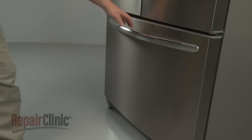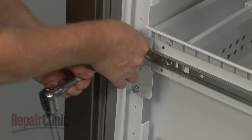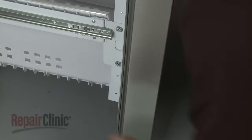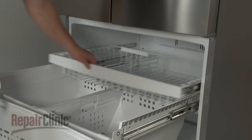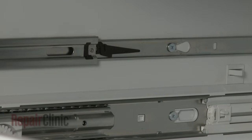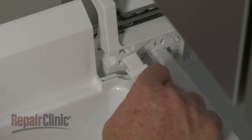To access components behind the freezer's rear panel, use a 3/8-inch socket to unthread the screws securing the front drawer panel to the drawer rails. Set the front drawer panel aside. Lift out the basket. Release the retaining clips and slide out the basket frame. Pull out the drawer retaining clips so you can lift out the drawer assembly.